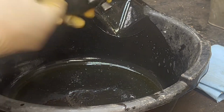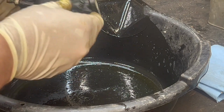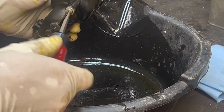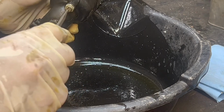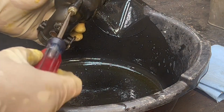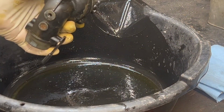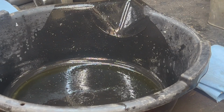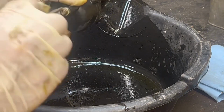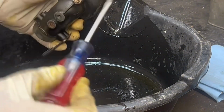So this guy's got some corrosion on the tip. Not too bad. Then we have this main jet here on the bottom. Same thing. Half a turn, one turn, another half. What is that? That's 1.5. Get to 2.5 turns, and it's bottomed out. So it's just good practice with any carburetor. Lawnmower, weed whacker, Corvette, and then you can go ahead and take it off. So this jet becomes a major player in our story.